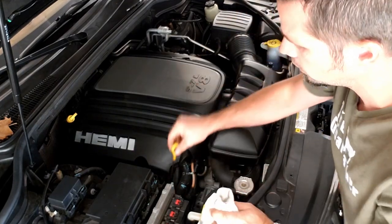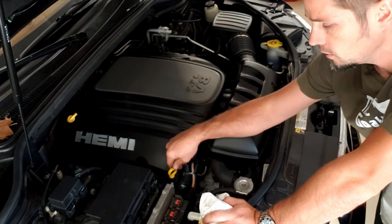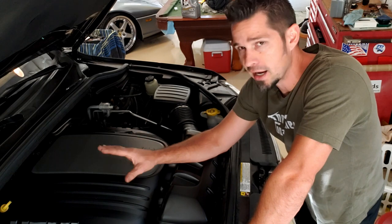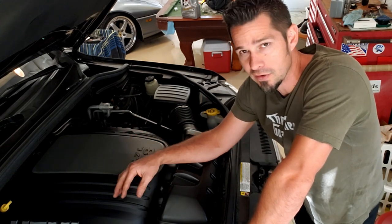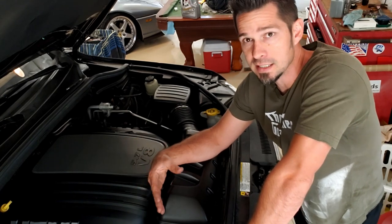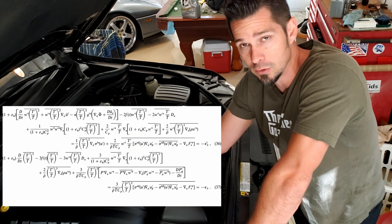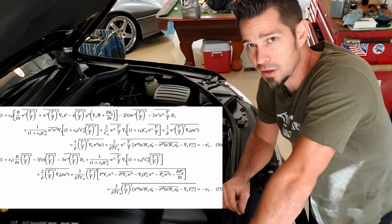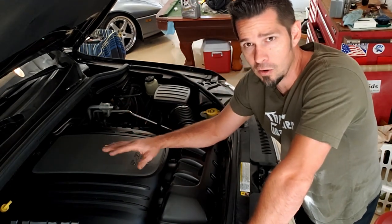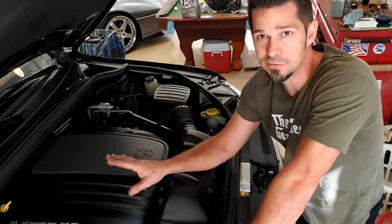The last thing you need to do in an oil change is get rid of the old oil. In Florida, if you sell oil they have to take oil — I usually take it back to Walmart or AutoZone and they let you dump it for free. So we're done — a fresh oil change with seven quarts of Mobil 1 5W-20 and a new filter for less than $25. The math: two jugs at $22–$25 with a $10–$15 rebate averages about $2.50 per quart, which is $17.50 for seven quarts. Filters from Amazon or eBay in five-packs come to about $7–$8. That's roughly $25 total, with free oil disposal. Great peace of mind knowing synthetic oil is in all my cars. Thanks for watching — hit that like button and consider subscribing.